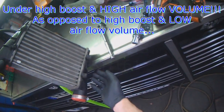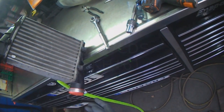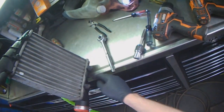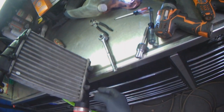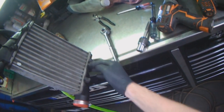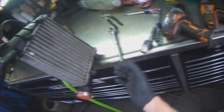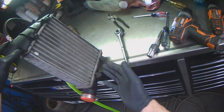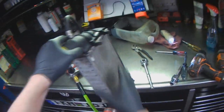This one here doesn't have what you'd call a splash guard. The ALH cooler is actually a little bit thicker on the bottom, and just under there there's actually a metal plate — so Volkswagen actually knows this can happen. When oil gets in and collects in that little pocket, the air rushes in, hits the pocket, the oil gets pushed over, the air comes around and goes up over that lip into the cooler. But again, if there's too much oil there's nothing you can do aside from draining the cooler on a regular basis. Once there's too much flow, that oil will get sucked up — or pushed up — under boost.